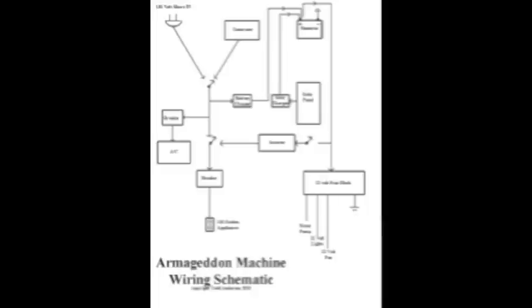The switching in modern RVs is also something that uses 12 volts. Our goal is to stay away from as many computers and microchips as we can. So we use manual switching. It's a little less convenient, but it's much more reliable. I'm going to put up a schematic here of how we wire ours, and if you want to pause it and print it out, you can.